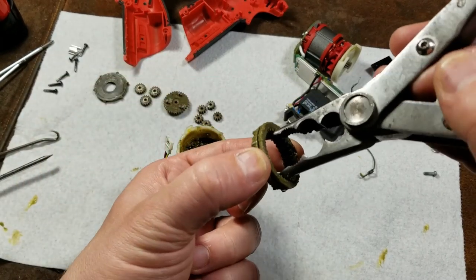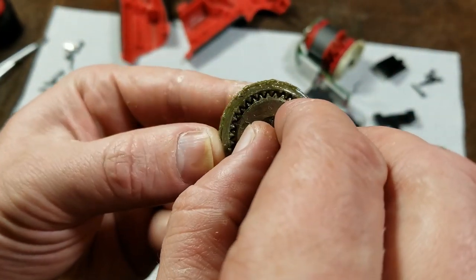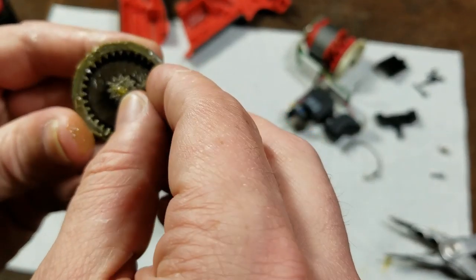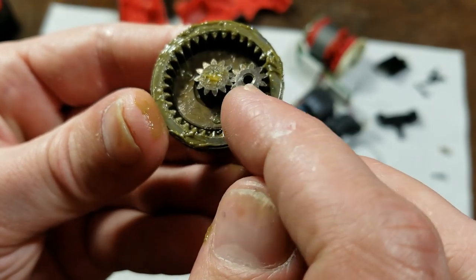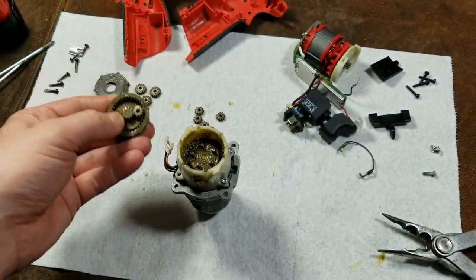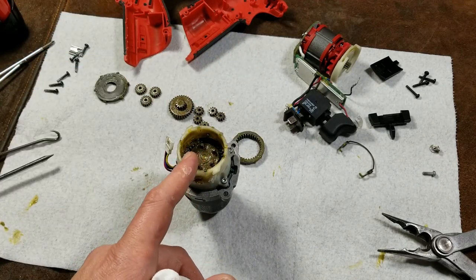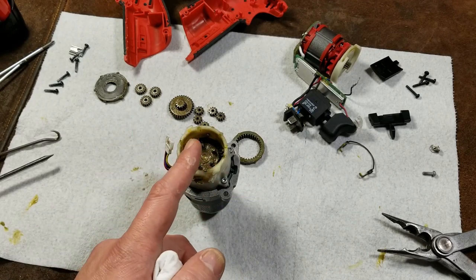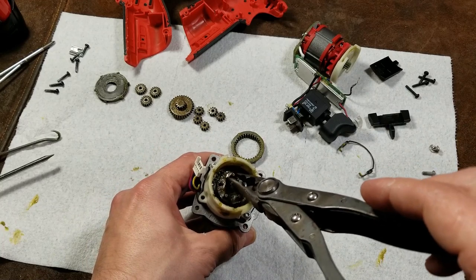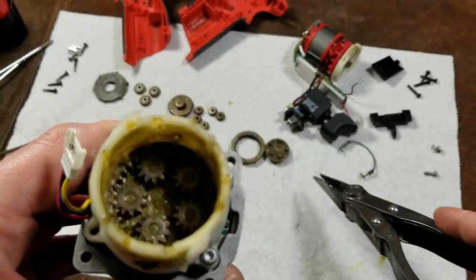When you shift into second gear, this will slide and lock up on those exterior teeth. As soon as it gets to that portion it halfway locks the whole assembly together with these gears and disconnects these splines, basically bypassing one stage — that's how you get your gear shift. It's simultaneously disengaging the second stage and letting it freewheel while locking it up, so all the force goes to the first and last stages. Here's our second stage carriage, and we have five gears in the final stage.